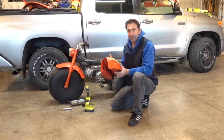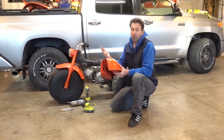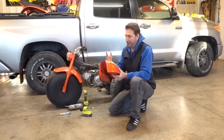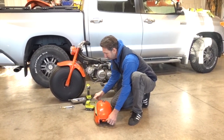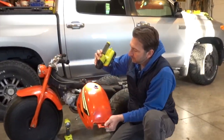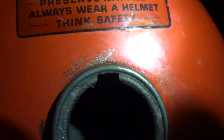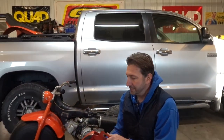And for the final step, they recommend that you wait 96 hours for the coating to completely cure. We waited an extra day. So 96 hours is 4 days; I actually waited 5 days. And it's completely dry. So I want to show you what the inside of the tank looks like. Bring that over here, Mark. I don't know if you can get a shot inside of there, but you can see the silver material that's inside of there. Not sure how well you can see it. Okay, not so close. All right, and ultimately that seals this tank up.